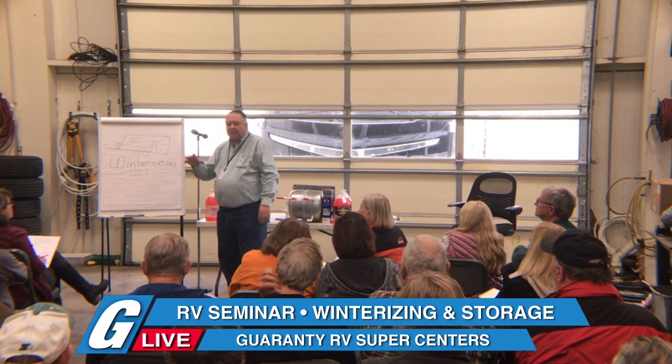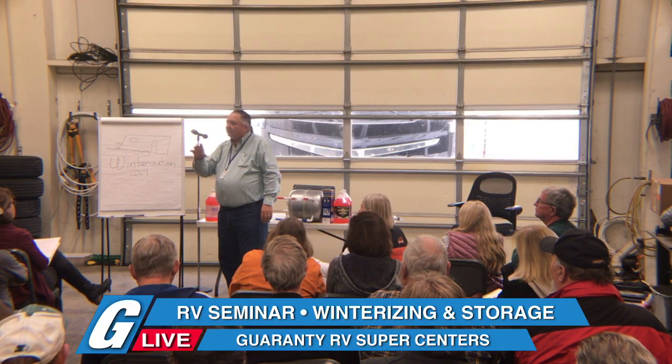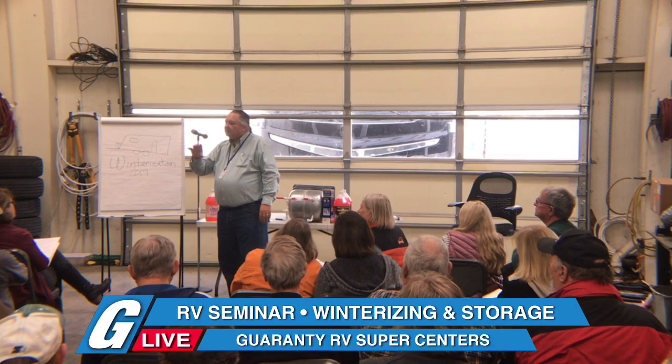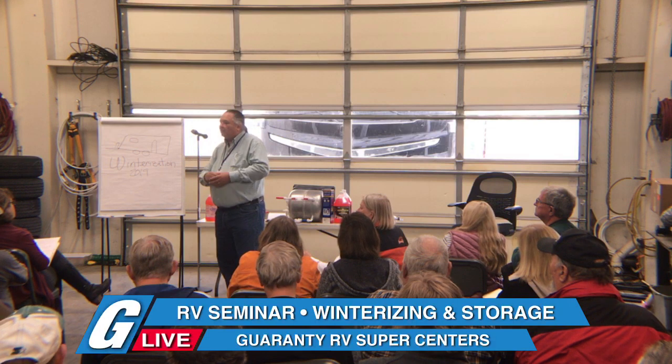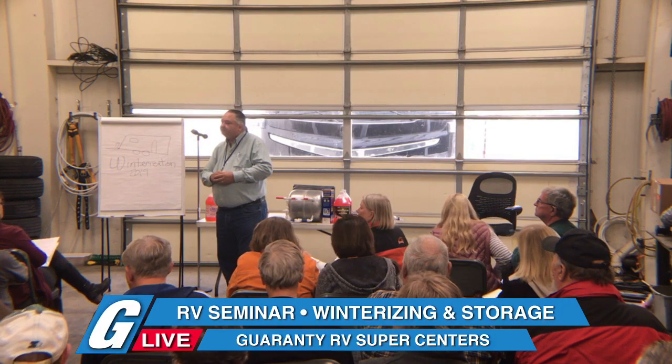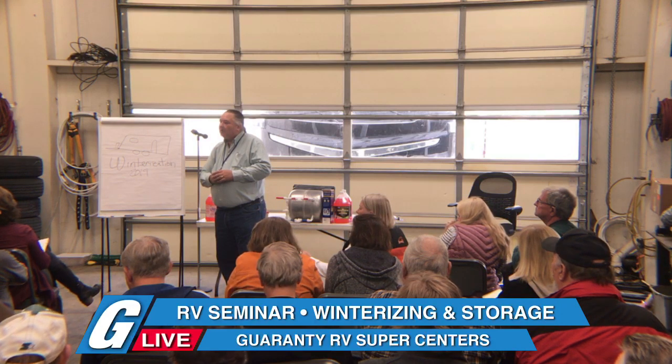And what we do, let's say you bring it in, we're going to put that termination collar on there crooked so the bottom half isn't attached. That way any water left in there is going to run out. Aren't you putting a gallon or so of water into that tank when you're doing the blowout process?